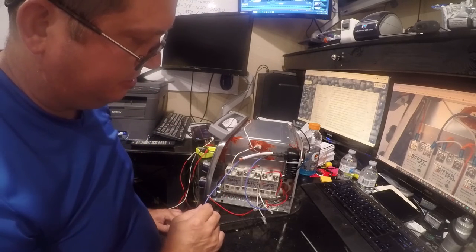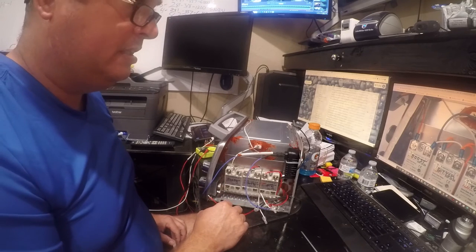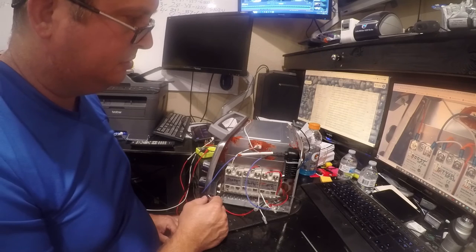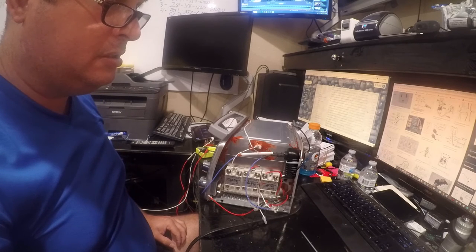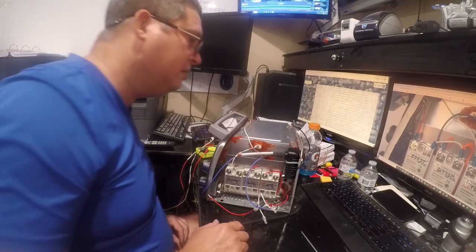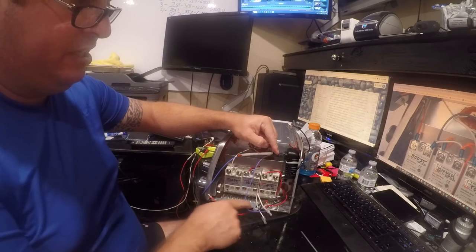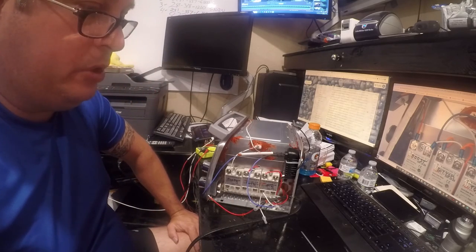Now, this needs to pick up power. And then we need power here and here and here. And we're going to get it from here. So, just notice he has his hooked up backwards in the picture, because this is the neutral. If you turn it around, this is the neutral. So it needs to go to the white wire, and this is the hot, which needs to go to this whole tree. So let me see if I've got any more hot high temp wire.